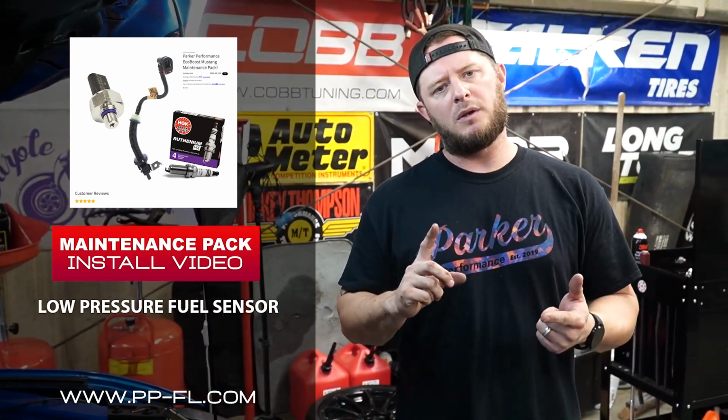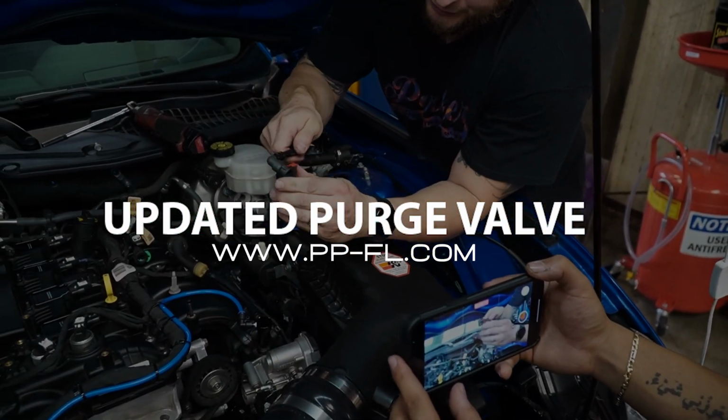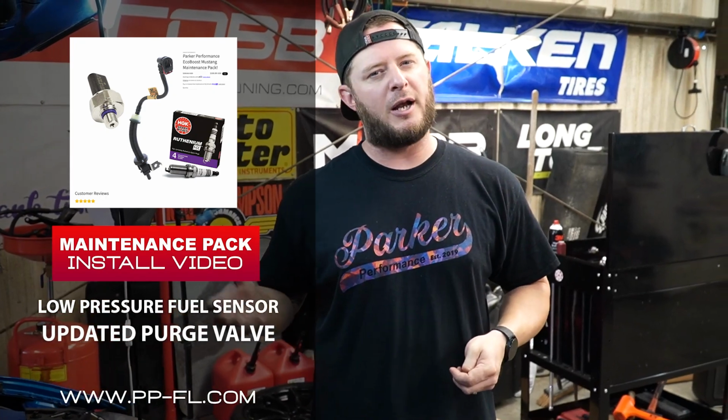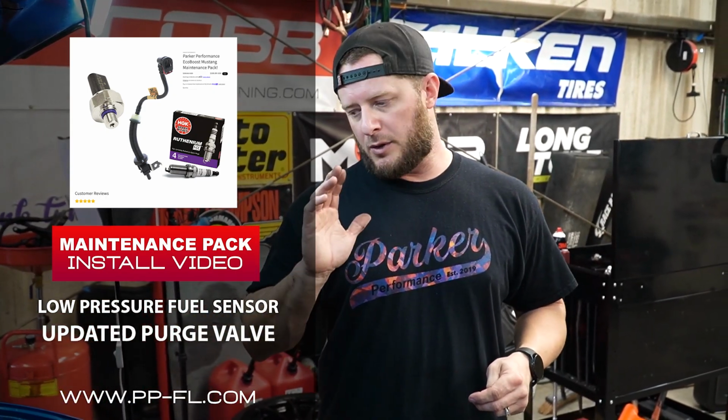So it's going to be the low pressure fuel sensor, the updated purge valve. Many of you have gotten the P1450 check engine light, unable to bleed up fuel. You fill up with gas and unfortunately the car starts to kind of bog on startup and gives you some weird vibes. That's going to be handled and resolved with a new purge valve.